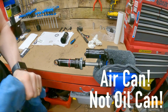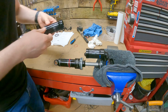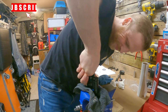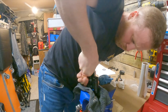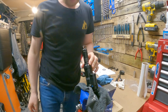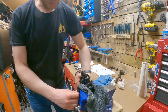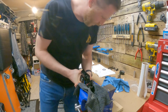We used a strap wrench to take the air can off, but we don't need to use any tools for putting it back on - we are just going to put it on hand tight. If you over-torque this you can damage the seals. You do have to apply quite a lot of force when pushing the air can back onto the shock. I've also put some grease on the thread just to stop that binding and make it easier to take off again in the future. We don't need to tighten this up with a strap wrench or anything - it's just got to be hand tight.